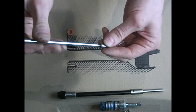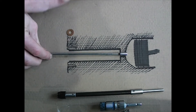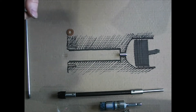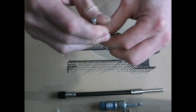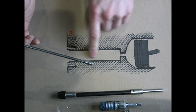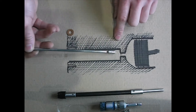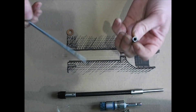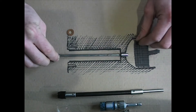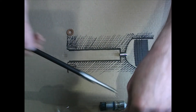The way you apply the top hat is to screw it very lightly onto the end of the insertion tool, feed it down into location, give it a little push, wind the insertion tool back out, and leave it in there throughout the whole process. I've seen a few people in videos who pop these things in, put an airline blower in, and sort of blow all the dust out — but by that point the damage has already been done. The contaminants could have scratched the liner of the cylinder, making them pass into the cylinder itself. There are six of them for six-cylinder engines. You insert them from the top into location, remove the insertion tool, and then get on with the business of cleaning.